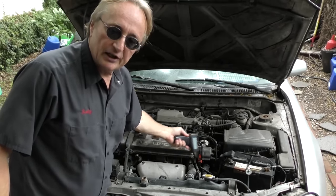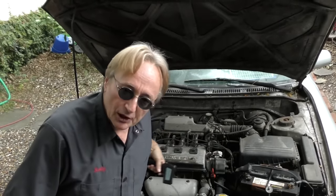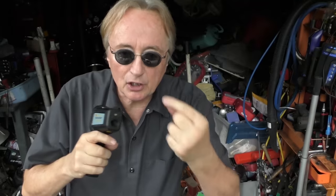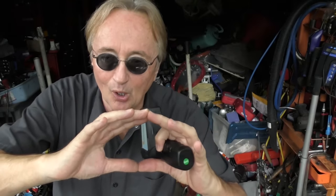Here's a tip on how you can check if your radiator is clogging up inside. These temperature guns are cheap — this one was about twenty dollars. When the vehicle is running, take temperatures of various parts of the radiator. If you find one area is a lot colder than the rest, that means that area is clogged up. It sounds crazy but it's logical: if there's a blockage in one area, no coolant is going through there, so it won't be hot like surrounding areas with hot coolant flowing through. Even though that area itself is cold because it's blocked, it's not cooling the engine — it just makes the engine hotter. When you find cold areas in the radiator, that means your radiator is shot and you need a new one.